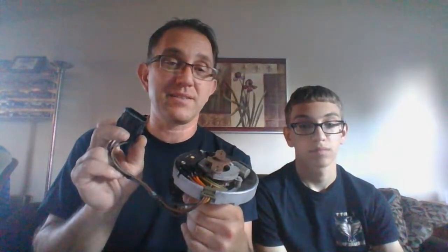But in 81, you can unplug this and the 7-pin module will go into a limp mode default deal and you'll gain spark back. But the check engine light's going to be on, and you're going to set a code, and you're only going to be running base timing. That's it. The car is going to be slow. It's going to be a dog, but it'll get you home. So that's the 81 distributor. That's the connector for it, and everything like that.